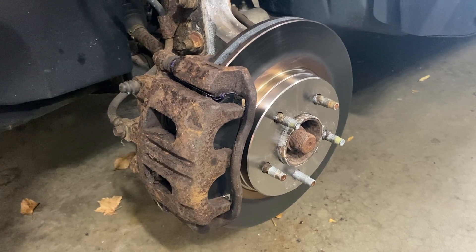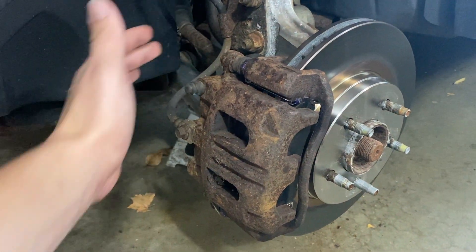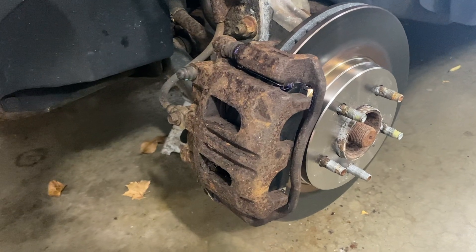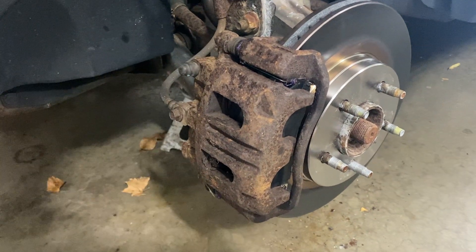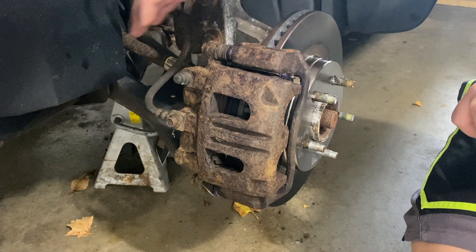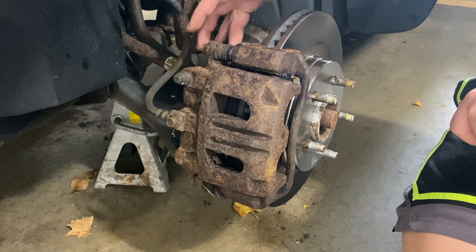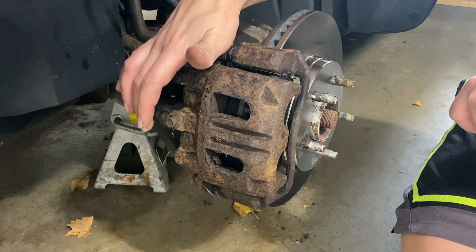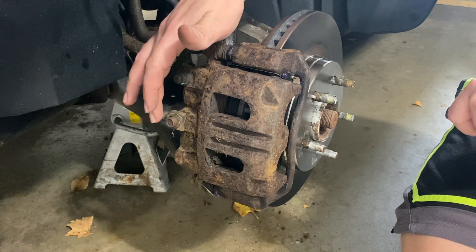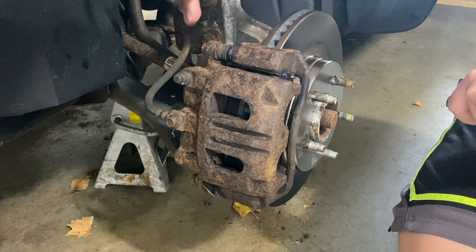I only went about a mile down the road, so it didn't go that far. Let's go ahead and start by taking off the brake caliper with the two bolts, and then we'll take off that bracket as well. The brake caliper is held on by two 14-millimeter bolts, the brake caliper bracket by two 15-millimeters, and the brake hose is held on by an 11-millimeter — seems kind of strange, but that's what fit best. So I'm going to go ahead and take all those loose.